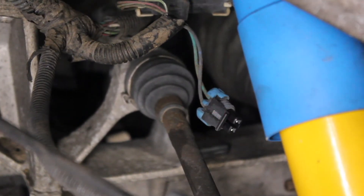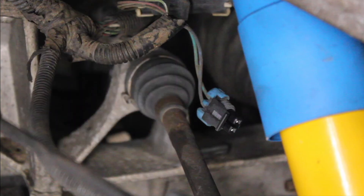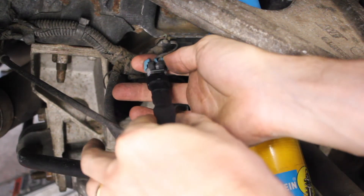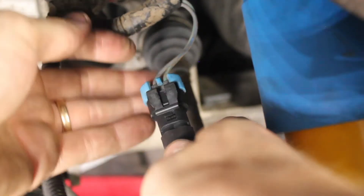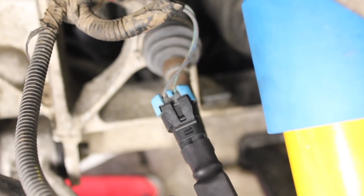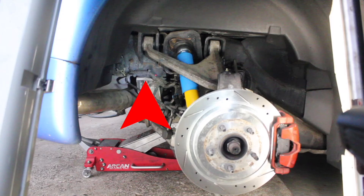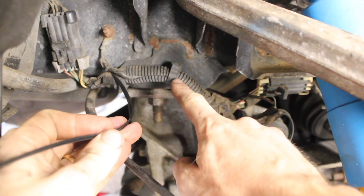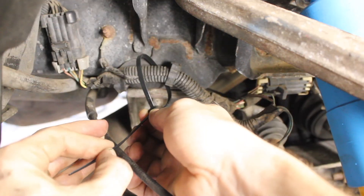Remember, if on your GM vehicle the connector is not a perfect match, you'll need to grab a set of universal adapters so you can cut off the connectors and splice them together with a wire crimp. Next, simply clip them into place. Make sure you secure your units in the correct orientation with the bump under the factory clip. The bypass unit should seat securely — don't force it. You may need to jiggle it around a bit in order for it to sit properly. Your bypass unit will now be hanging and it needs to be secured to the chassis. A good location for this is the factory wiring harness. The best location will vary based on your vehicle, just find somewhere secure to zip the bypass in place.